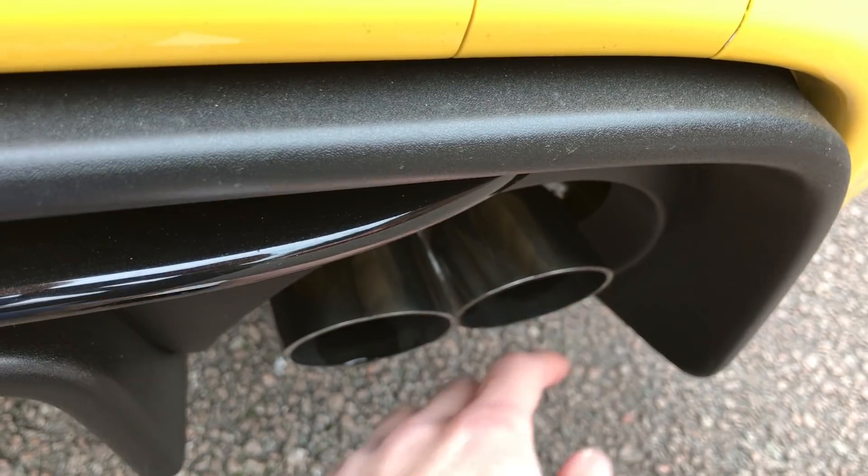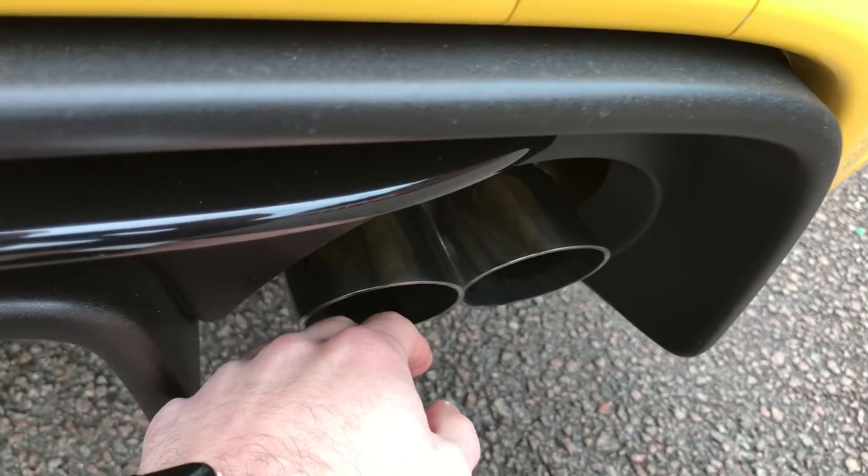All in all, I've just taken it on a little test drive now. It feels like it makes a bit more noise in the higher rev ranges, because it feels like it's a bit more free, now that the valve is just sitting open. I'm pretty sure it's just sitting open — it doesn't seem to want to come back closed like the spring was pulling it. The conclusion I've come to is basically just unhinging the spring on one end. It's still actually attached — it's just allowed the valve now to just be open.